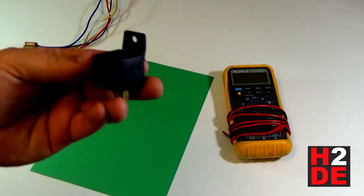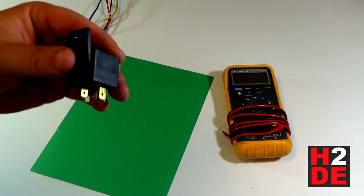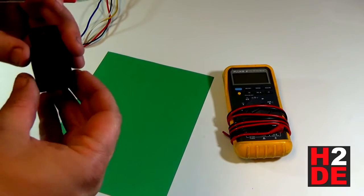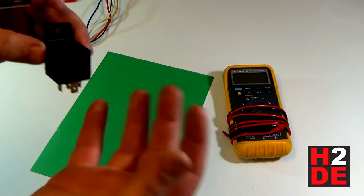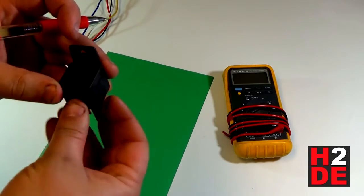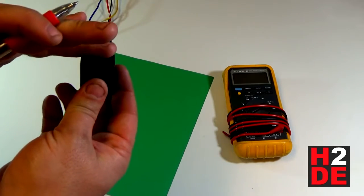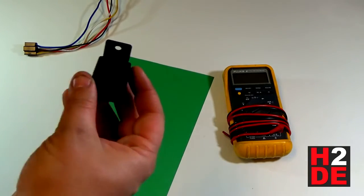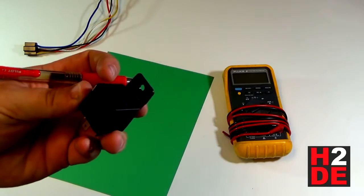If you're not familiar with a relay, basically all a relay is is a switching device that allows you to separate voltage. If you have a circuit that doesn't have a lot of current, you can use that to switch another circuit that has the current you need to supply to a device. It's a way to avoid running a large current supply into your cabin to a switch and back out to a light or accessory that draws a larger amount of amperage.